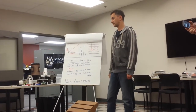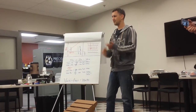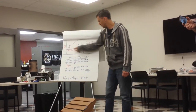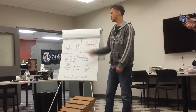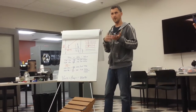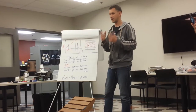So punch control, same thing. If you have a fast buggy, fast car, turn the punch control down. You'll probably not notice that much when you're driving, but it'll make a huge difference to the battery life because punch control is how much peak current it'll put out. ESCs that have current limiting on them, the race car guys do that, right? You limit the current on them so that you can get your full speed on the straightaway without having to limit the throttle and stuff like that. You can set ESC parameters for that.